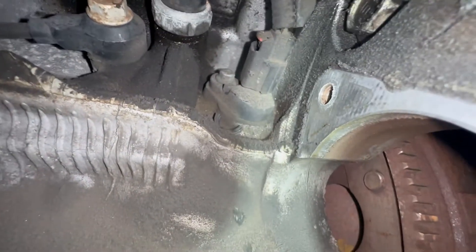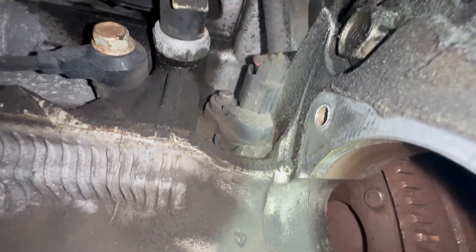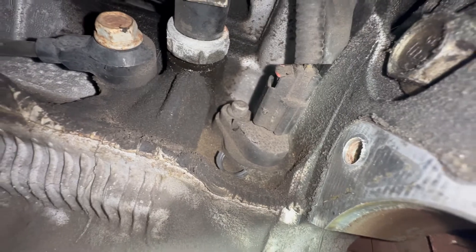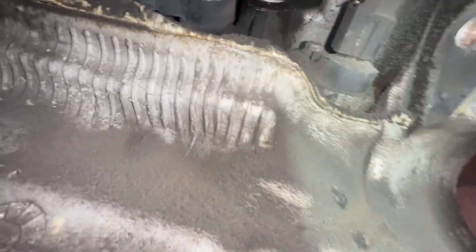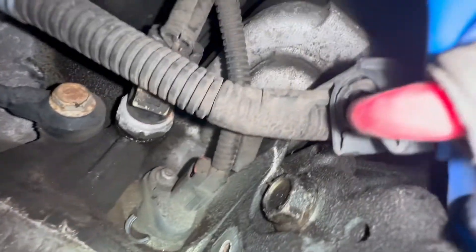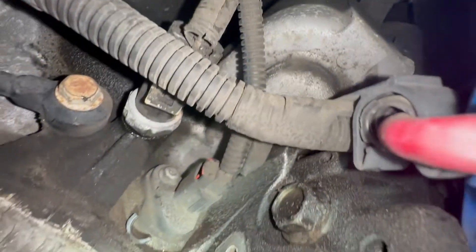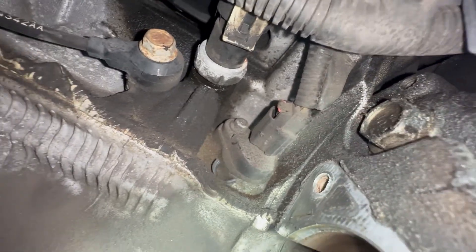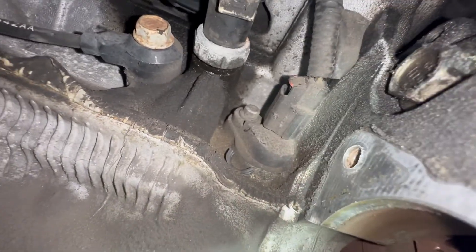I'm going to put the camera inside so you guys can see the crank sensor I took out. There it is — your crank sensor. It has an 8 millimeter bolt and a connector. That thing should just come right out and go right in. This is the best approach unless you can fish it from up by the oil filter housing, but it's gonna be a disaster that way.